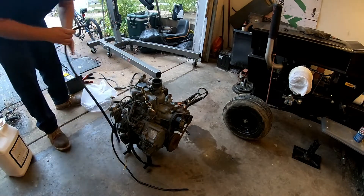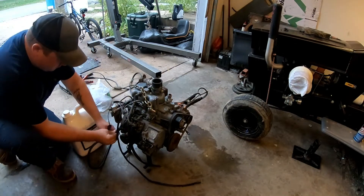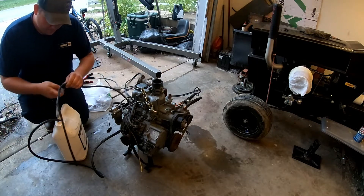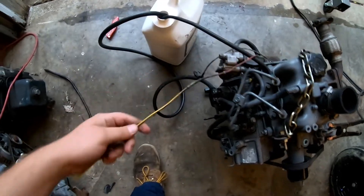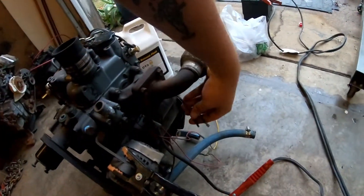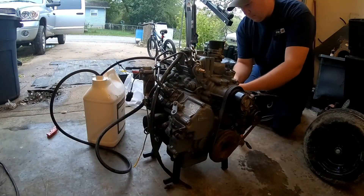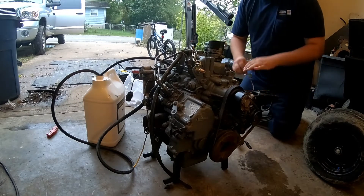Got the fuel hose here, got the diesel - this is not death, just so we're clear. Here's the fuel return, it's kind of crappy looking but I think we'll send it. Got the fuel lines hooked up. That's the glow plugs I believe. Got the battery hooked up. I believe this is the shutoff solenoid, so I'm gonna have to wire that in direct just so I don't have to hold it. We're gonna see if this dude will run.